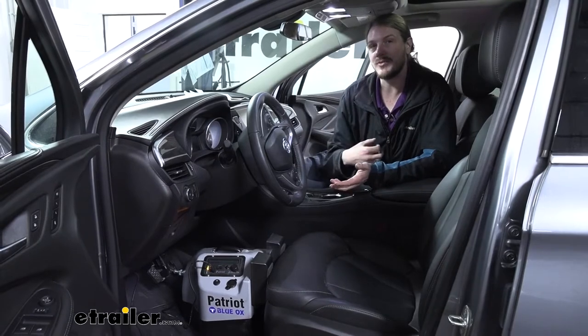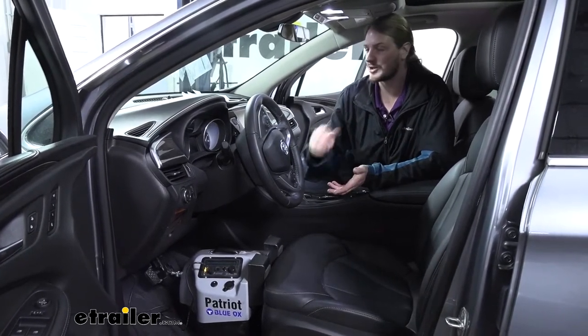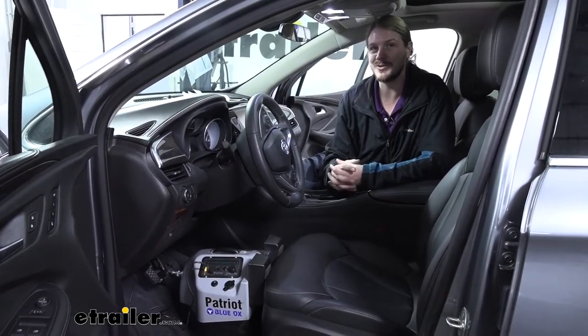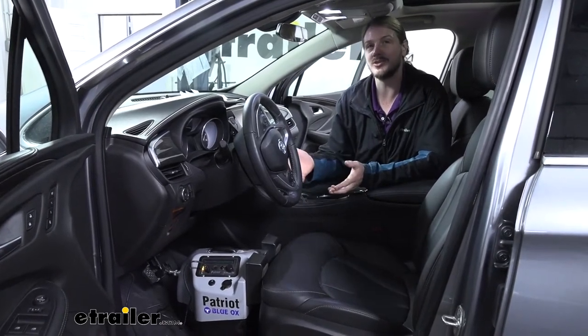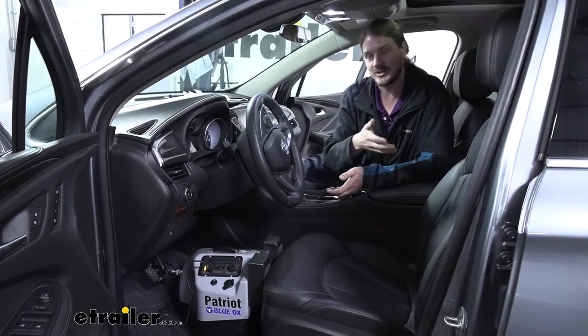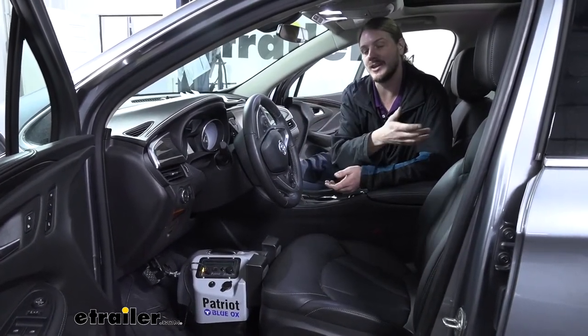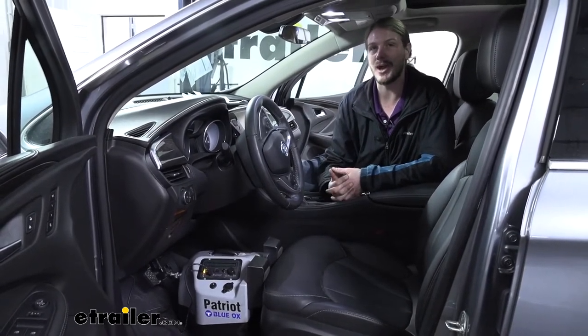Me personally on my vehicle, I've installed one because my outlets stay powered up all the time even when I turn my vehicle off and go inside. I've got an aftermarket seat heater that I've left on quite a few times and drained my battery down. I installed a 12-volt outlet kit on an ignition source, so it's only powered up when I'm driving the vehicle, kicking my seat heater on. When I'm done, turn the key off, it disables that circuit and I don't have to worry about draining my battery down anymore.